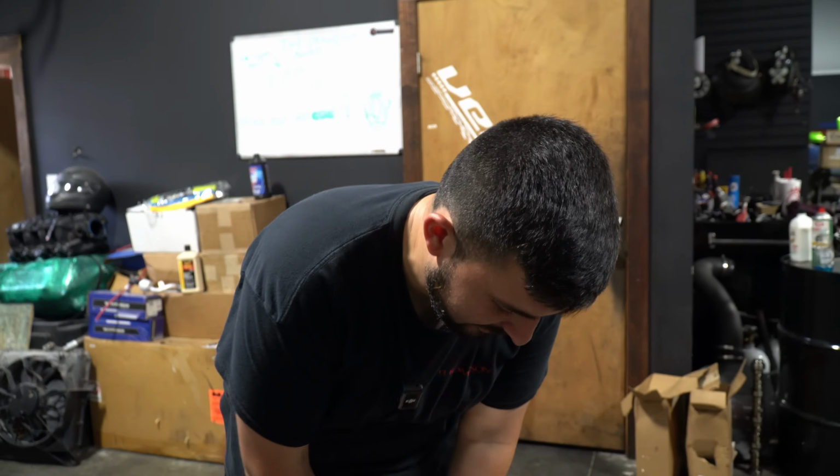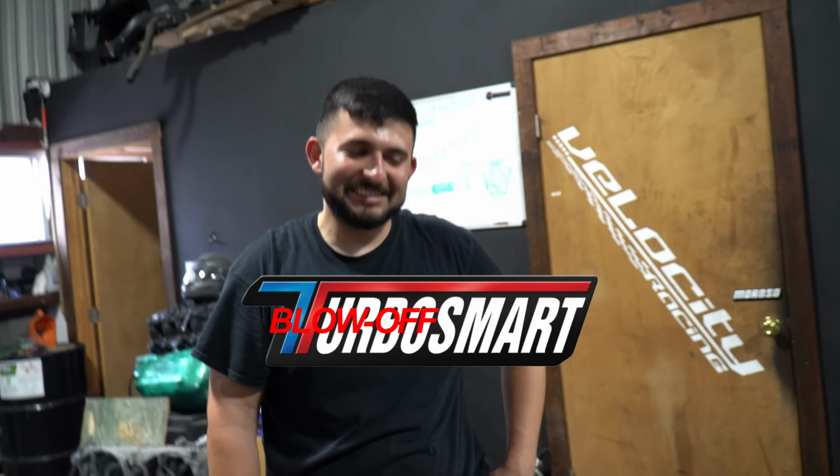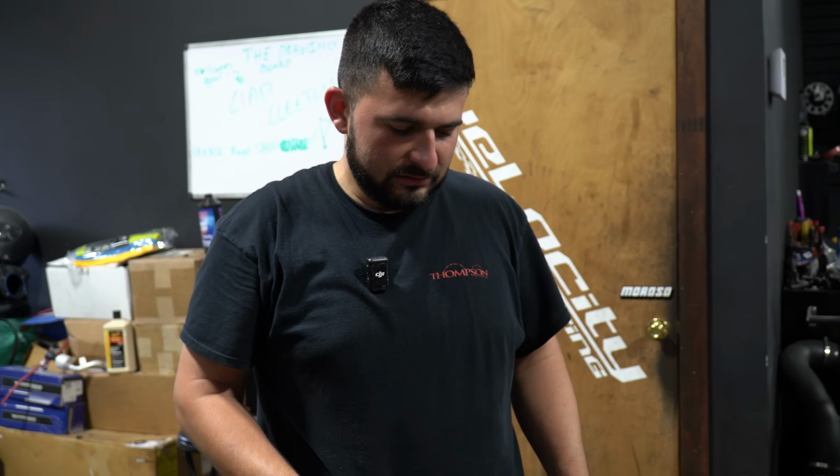But as time goes on, we'll put in E85, we'll turn up the boost, we'll put in a bigger motor, and just like any truck, a snowball effect. Eventually, you'll probably have a TH400 on a Motec and God knows what. But for now, just that. I'll stop it right there. And I'm sure I said it, but in case I forgot, it will come with a blow-off valve. That was the Turbosmart blow-off valve with twin Turbosmart 45mm gates. So for now, I'll stop talking and show you a little bit of the progress.